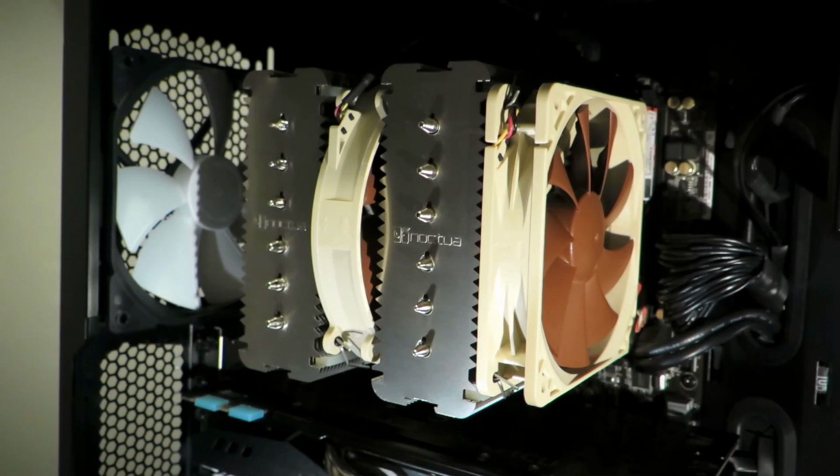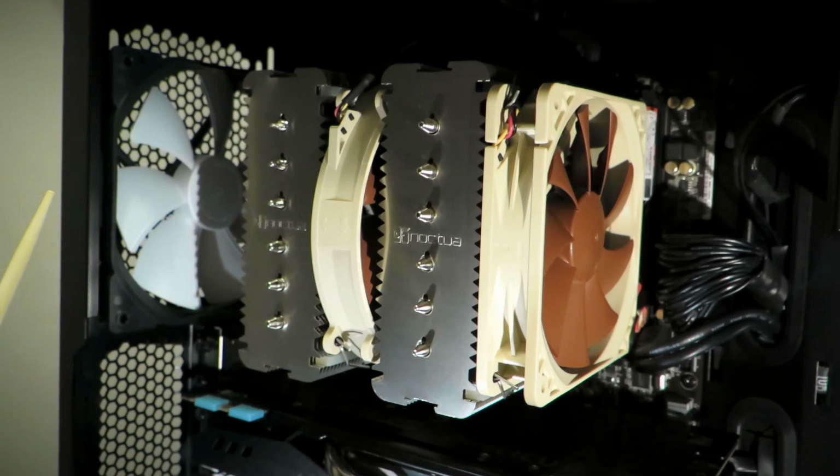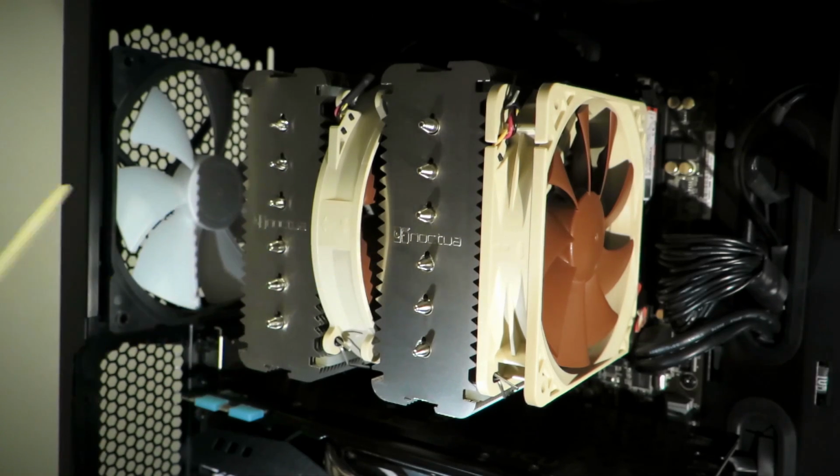Now, you can't actually see the processor on this computer, or any computer really, because it's buried underneath this mountain of aluminum and copper, which is a heatsink. And that's here to keep the processor running cool and efficiently. Processors generate a lot of heat as they operate. But the processor itself lives way down under there in a little square socket on the motherboard, and we'll get to the motherboard shortly. But it's about 1.5 inches square, and you just plop it into the socket, and you put down a little bracket over top of it to hold it in place. And then you install the heatsink on top of it.